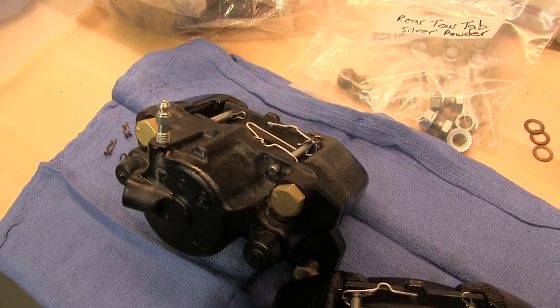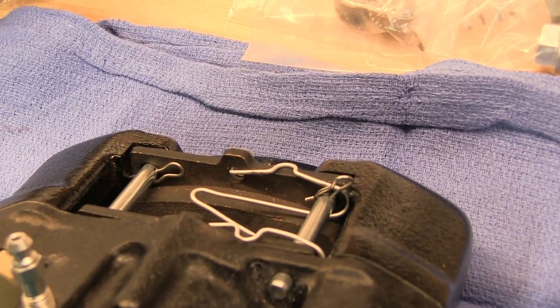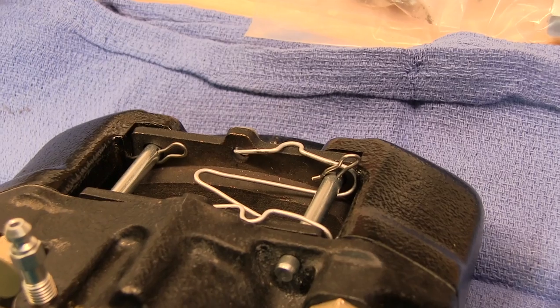One last note about the brake calipers: the aftermarket brake pad guide pin retaining clips stick up quite a bit. Original equipment Mazda had low-profile clips. I think I'm going to send those off to the platers — I've got a whole batch going to the platers tomorrow, so this is perfect timing. I can replate those low-profile clips and use them again, rather than using these big honking ones that came in the hardware kit.